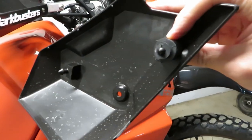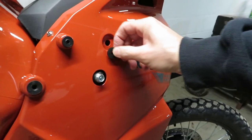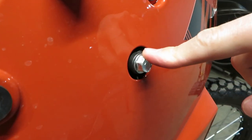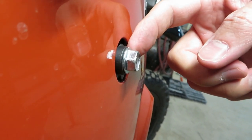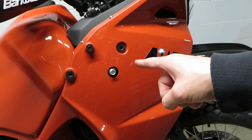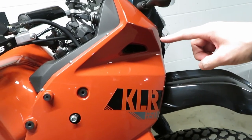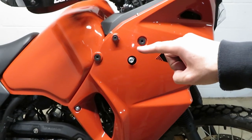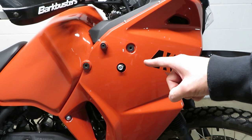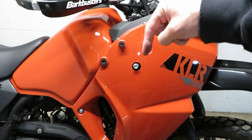It just pops off like that, and this is supposed to stay in the fairing - of course it seems like it never does. Pull this back off and stick it back in the fairing before you try to reassemble anything, otherwise it won't go well. This is the bolt that we're after. As you can see, it doesn't really hold the fairing on and it does protrude past the fairing slightly. That bracket we're going to be mounting is going to be sticking off this direction, and I'm not going to lie that does make me a little bit nervous. However, you should be getting plenty of support from the mounting bracket down on the frame, wrapping around and building off the other supports. I will definitely be keeping a close eye on this in the field.